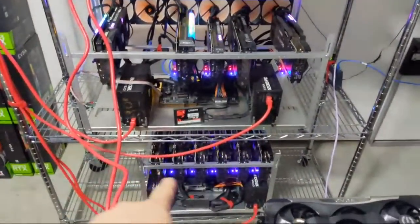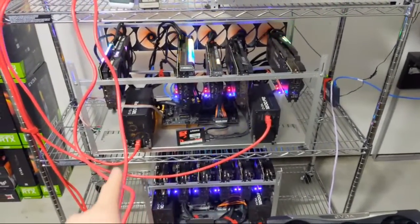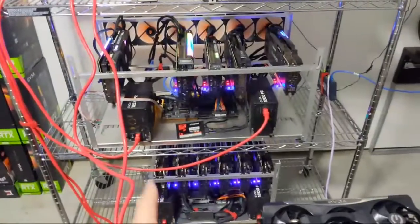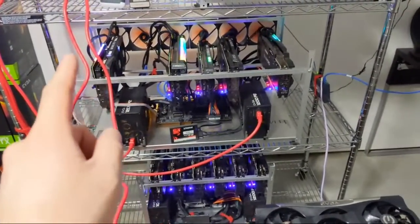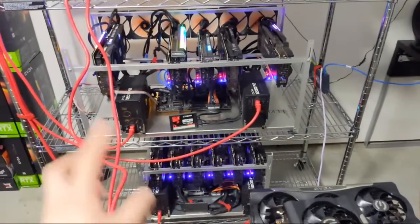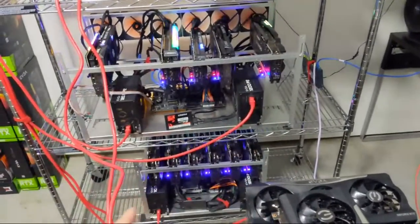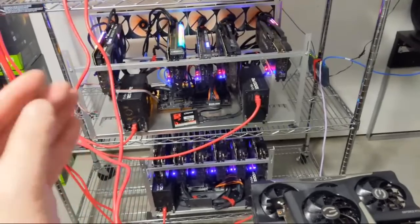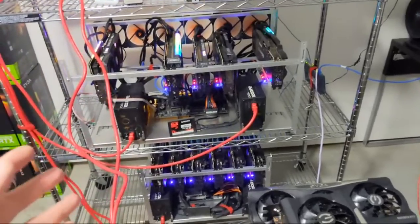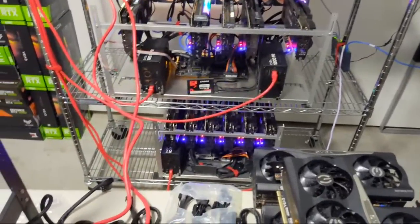I have 11 RTX 3080s here. They all get different hash rates, and it is so dependent on the ambient temperature and the temperature of the cards. The GDDR6 memory is so hot on both sides of the card that the backplate is scorching. The backplates don't even provide enough cooling anymore. That's how bad the GDDR6 memory is. It's brutal.